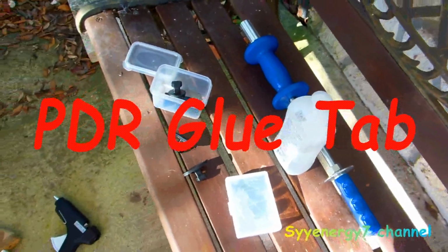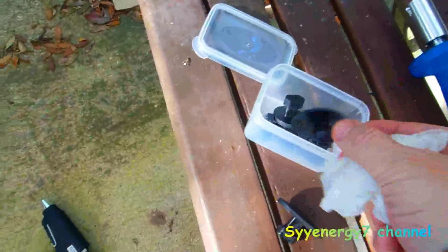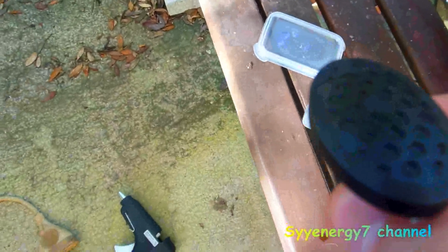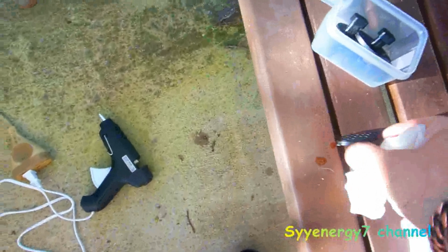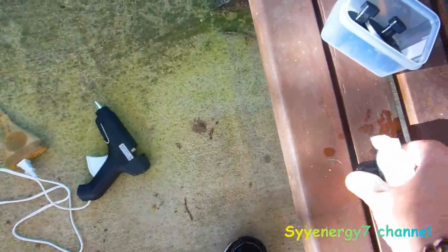Well, I'm getting ready to pull my first little dent with my glue pull kit. I got a little dent up here by the mirror. Perfect candidate for its, what do you call it? Crease. So, what I'm going to do is, there's a couple of these long types, and this one's flatter, and this one's concave. You can see it's concave. That'll fit inside the crease, and we'll clean that off first too, make sure it's clean.